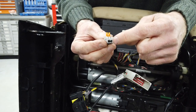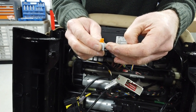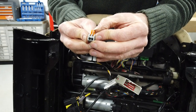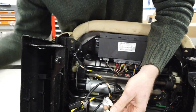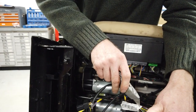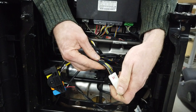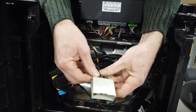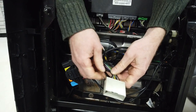You open the Wago connector like this and poke the wires in. You can get these in two-way, five-way, three-way - whatever - and it will join all the wires in the unit together. Put two wires in and it joins them both. It's got little clips and when you close it down it grips the wire. They should be rated enough to take the power for this. Let me cut that off to give me a bit more room - it's fully taped up. Let's free those wires.